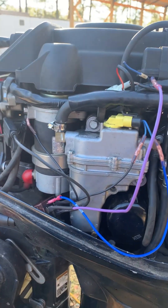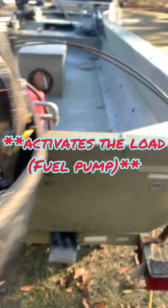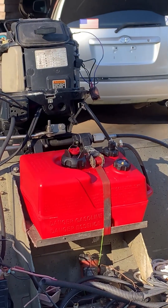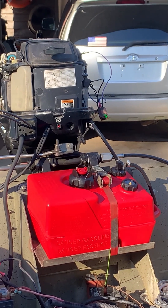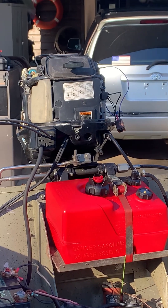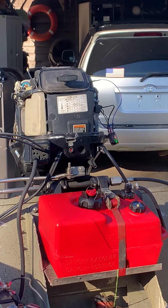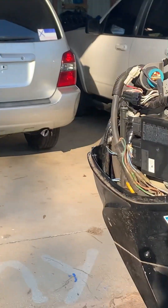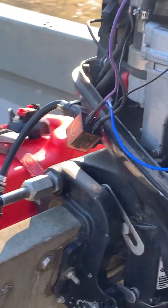Hopefully this will help y'all save some money. There's a green light that comes on this relay once it finally gets power. It would not start unless you relieved that fuel pressure or delayed the power on to that fuel pump. This is a very easy fix — it fires up before the power comes on to the fuel pump. There's just enough fuel pressure in there to get it started, and obviously too much fuel pressure doesn't allow the injectors to work. Cheap and easy fix. If you have any questions, let me know.